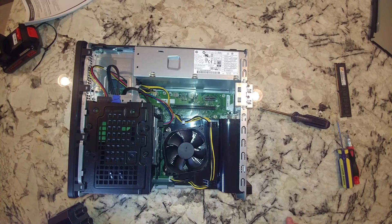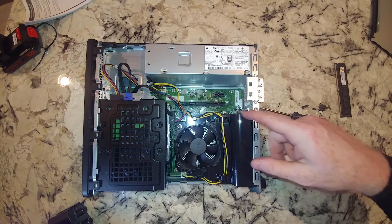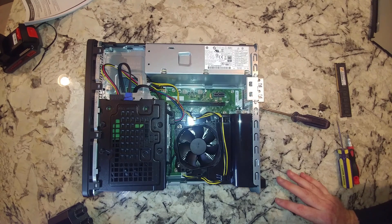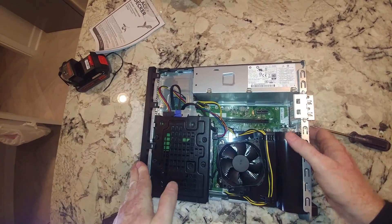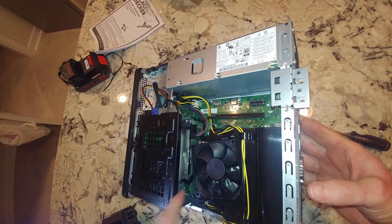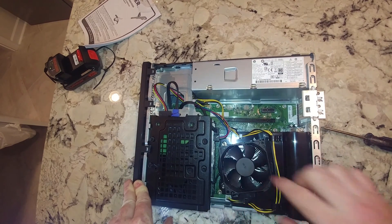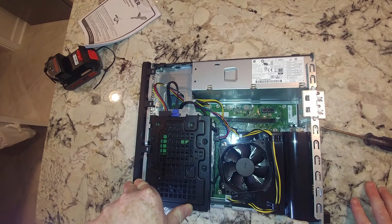Alright, this is a bit scary folks — there is not a whole lot of room in here. I had considered installing a graphics card; I think there's probably only one out there that we could use, and that is the NVIDIA GT 1030. Otherwise this is not going to be upgradable. If we tilt this over, you can see there's a 4GB RAM chip there, which is a total joke. Your CPU is going to be under the CPU fan, which has a little vent to shoot air out to the back.